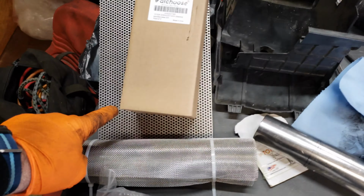So the scrap metal bin has provided me with a cherry bomb muffler that I took off the Datsun. So it was just still sitting in my scrap metal bin. It is a little bit larger here as opposed to the stock muffler that I'm going to build, but this should give me enough that I can at least make the curve on the end with it. I'm basically just going to clamp my metal to the muffler, and I'm just going to hammer it around, try my hardest to make the outside of the muffler that.